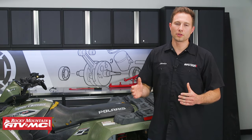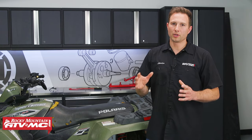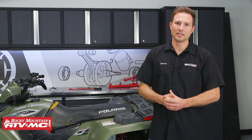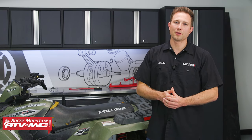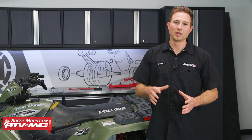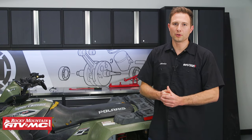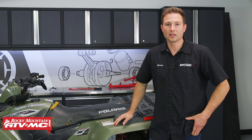If that's the case with you, you can get an aftermarket or an OEM part. An example of when it would be more cost-effective is if the sheaves on your drive clutch are completely worn out and they have deep grooves in them — chances are the rest of the parts of the clutch are going to be worn out as well. So in this video, that's what we're going to focus on: just replacing that primary clutch.